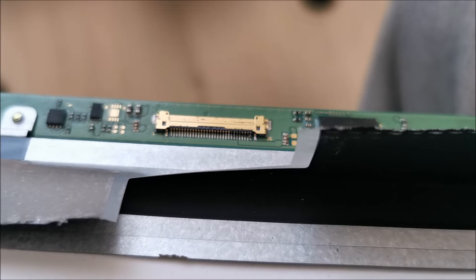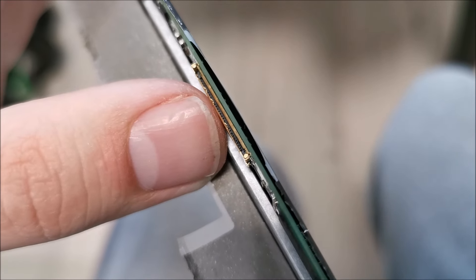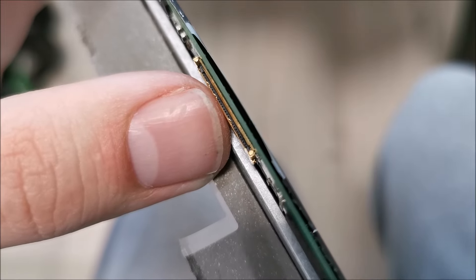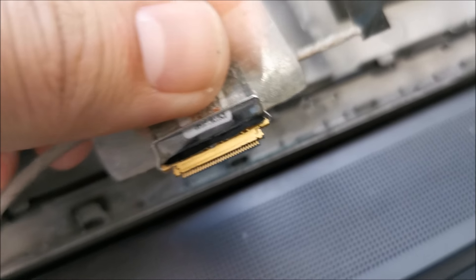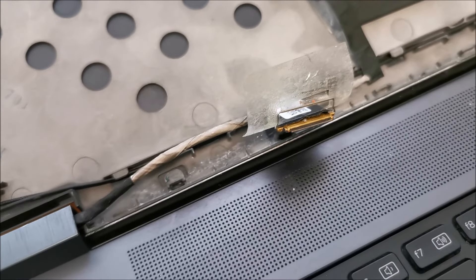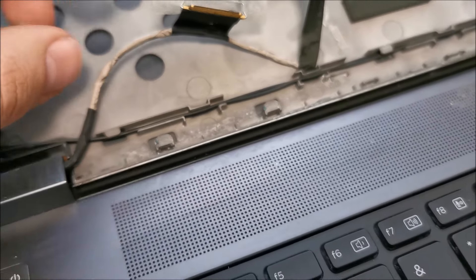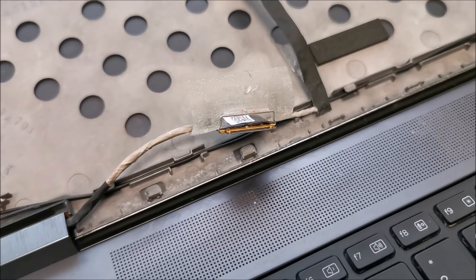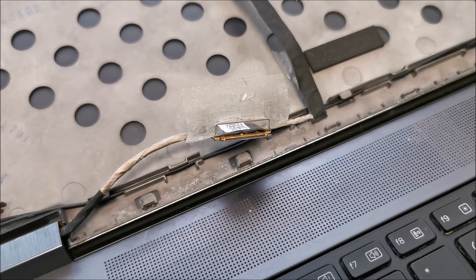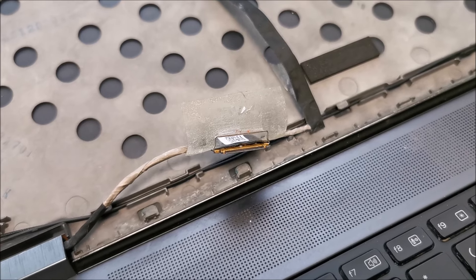Brush, alcohol, lots of elbow grease, and hopefully the contacts themselves are still there just with a layer of corrosion on top. Because if they are corroded through, then bye-bye display panel. Panel is looking better — the connections are still there. On the inside, really hard to tell, but I think it's okay. Cleaned the best that I could. The cable — I'm 99.9% sure I saved. So worst case we are changing a panel, not a panel plus a cable. Did my best to also clean this. There are some marks remaining but it will not corrode further. So in theory, quick assembly and try to power it on.